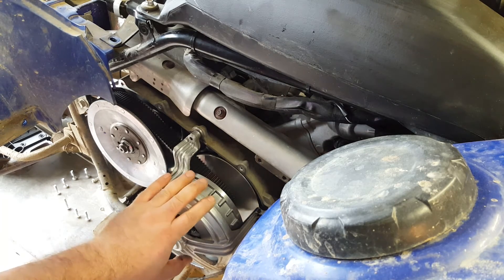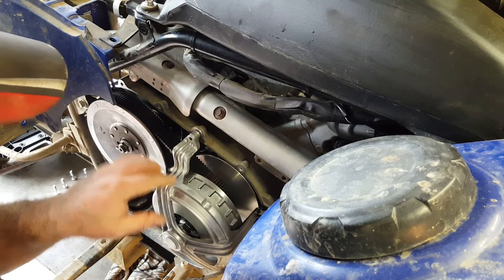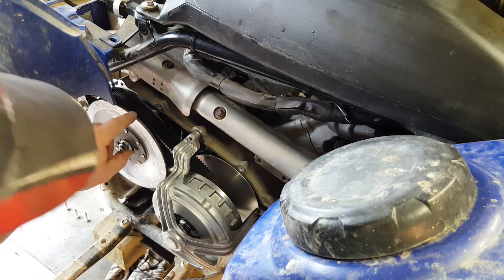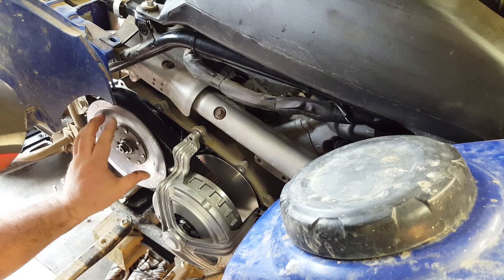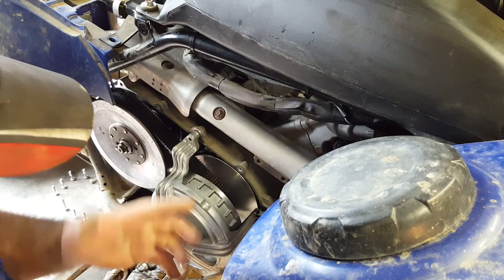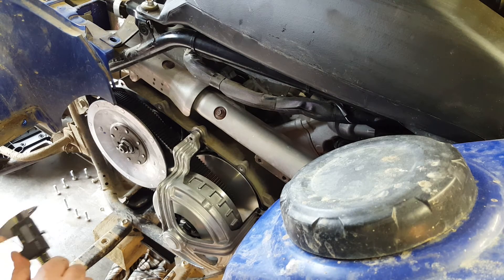So here you can see we've got the CVT drive, and this is the drive belt. We've got the two conical pulleys. To change the gearing essentially, this pulley squishes together so the effective diameter increases. And this pulley here basically goes the opposite — it spreads apart the two cones and the belt drops down towards the center. So essentially the effective diameter of that pulley reduces whilst this one increases, and of course it changes the ratio. Now we need to measure across that belt, and I'm going to use a vernier caliper for this — it's about the most obvious tool.